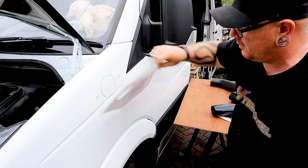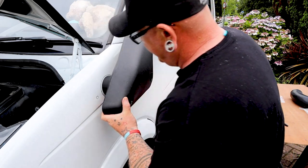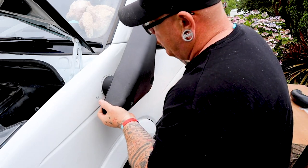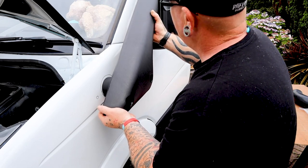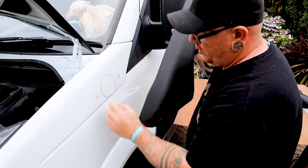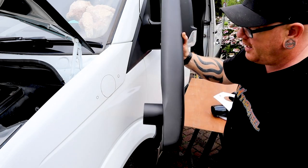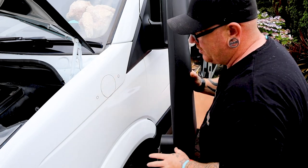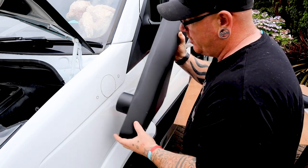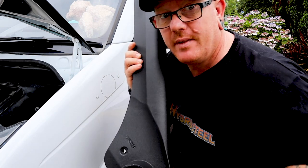Now we've got our hole transferred onto the van, we can take it off. You can see there, once you get the snorkel up, that is where it's going to sit. There is going to be a little bit of play, but we're going to drill the big one first. Get the big one drilled, and then we're going to drill these two last, because these two might need a little bit of adjustment. Once we've got the big one drilled, we're going to look through there and just see, on the position of this, where it's all sitting nice and true on the van — are they in exactly the right place? Because I don't really want to go fully off the actual chart, but first of all we need to get this big one out, because this needs to go through the van. So let's get that hole cut and get this stuck on.